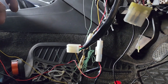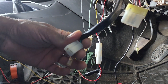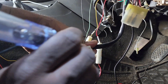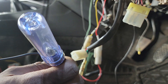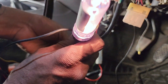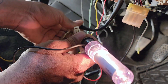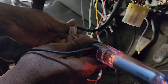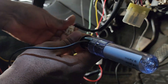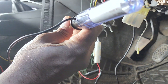This is my test light — I have it hooked up to ground up here with the gator clip. I'll go through each of these pins and figure out what each one is connected to on the ignition. This flat one here is always live even without the key, but the other ones are dead. With the key in the on position, this one is still live — that is the on signal. The next one is accessory, and then this separate wire is the ignition when I crank it.